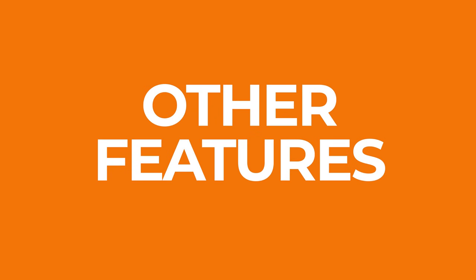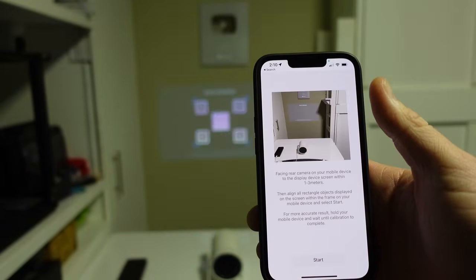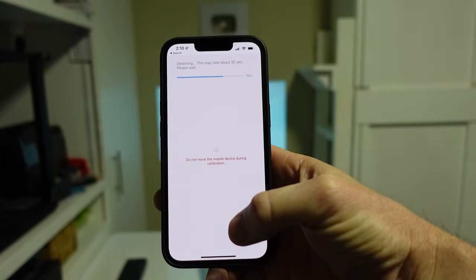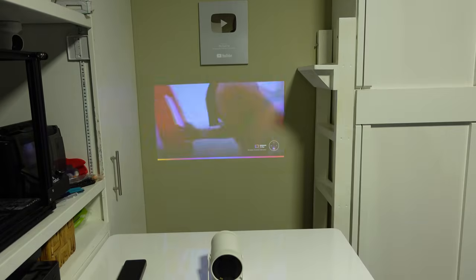There are a few other features advertised in the sponsored videos I need to address. First, putting a lens cap on your projector and calling it an ambient light lamp is ridiculous. Not only does the ambient light mode look pretty lame, but this is a $900 projector with a maximum lamp life of around 20,000 hours — an RGB light bulb costs $20, is cheaper, more convenient, quieter, brighter, about 5 times more energy efficient, and won't waste your projector's limited LED lifespan. Second, the Freestyle is supposed to have auto color correction that detects the color of your wall and modifies the projected image accordingly. However, this requires a compatible cell phone, adding your projector to Samsung SmartThings, and running the calibration process on your phone any time you move the projector. So while this feature technically exists, it shouldn't be thought of as automatic, and most people probably aren't going to use it at all.